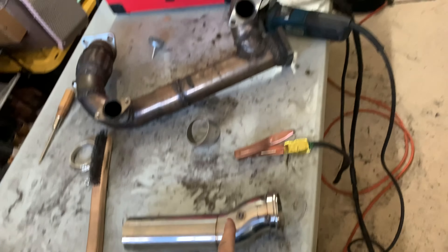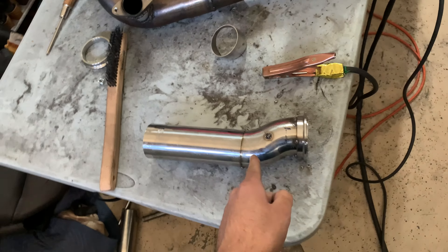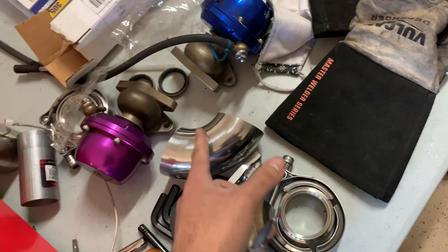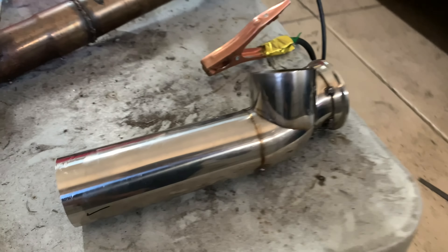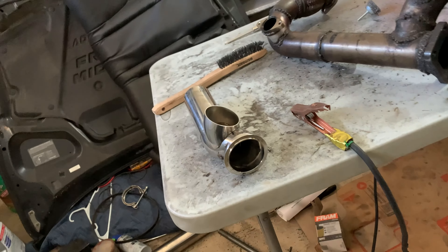Here's the front of the car — you can see the sway bar, the subframe, and the power steering lines. Here's the piping. On the new manifold I messed up and the pipe dipped too low, so I had to cut it about right here and remake that section. This is the remade part, and now we're starting to work on the merger so we can move on to the next bank.